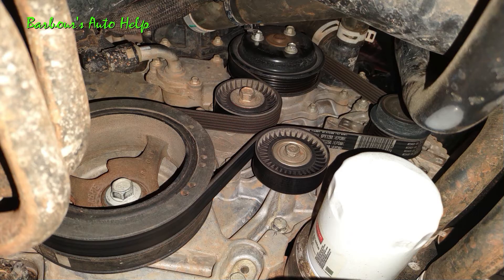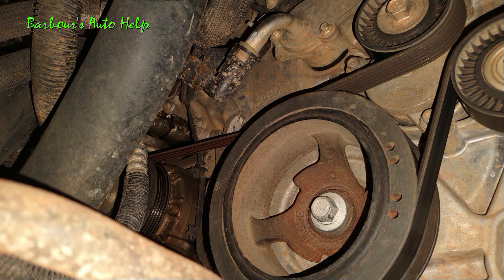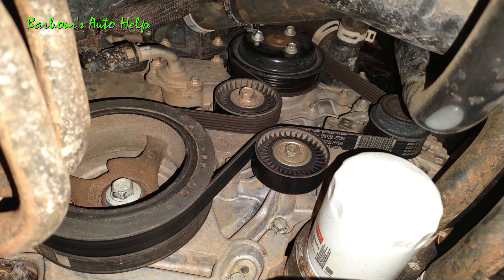What you're looking at right here is your serpentine belt, and just to the left of it behind the serpentine belt, that's your AC belt. So naturally the serpentine belt is going to have to come off first before you can take the AC belt off. The way you do that is by releasing the tension on the belt by rotating the tensioner counterclockwise. You take a ratchet with a 15 millimeter socket, place it on the head of the bolt on the tensioner, and you turn it counterclockwise. Once the tensioner stops rotating, don't keep forcing that bolt. You just want to turn that tensioner counterclockwise just enough to remove the tension from the belt so that you can remove the belt.